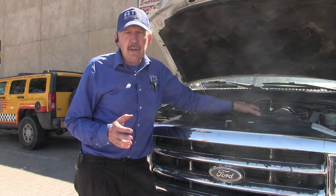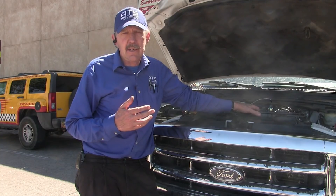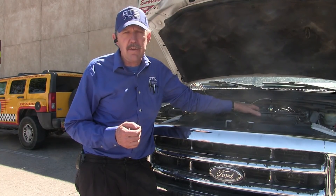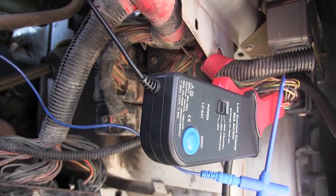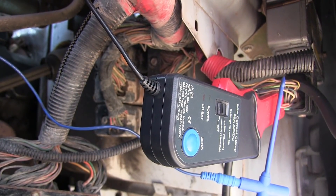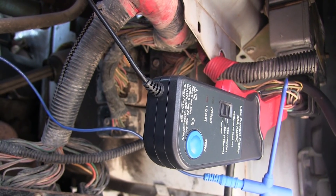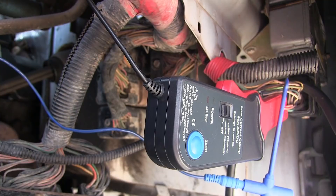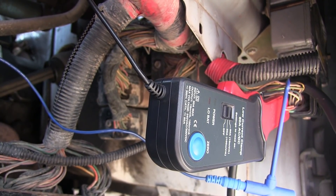What I want to do is I first connected a scope and I've got some things connected to this vehicle before we go for a test drive. Here we're at the FICM — it's under the wheel well on the driver's side. I've got an amp clamp on the two power wires that power the eight injectors and I've got the number one injector targeted. That will give me a reference for our waveforms.